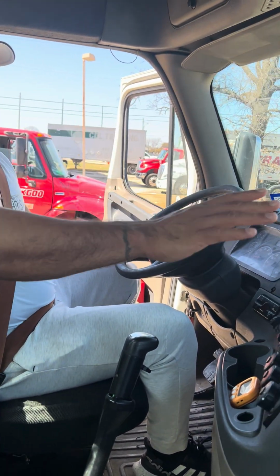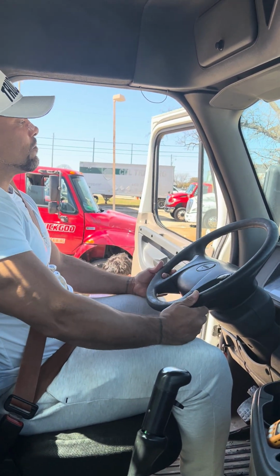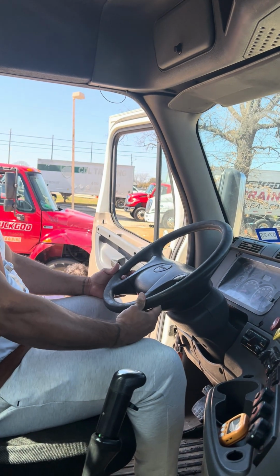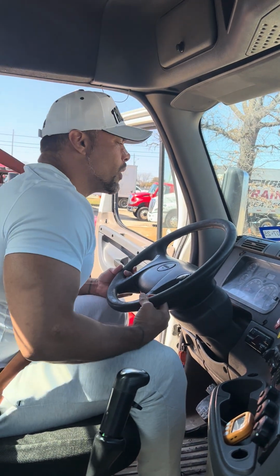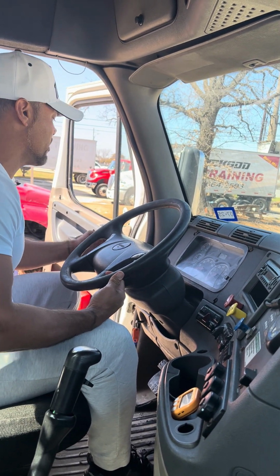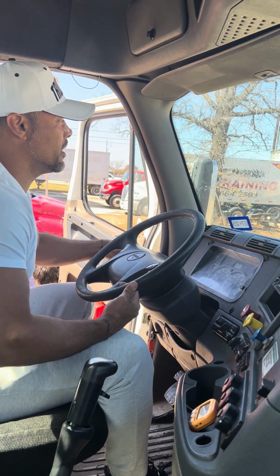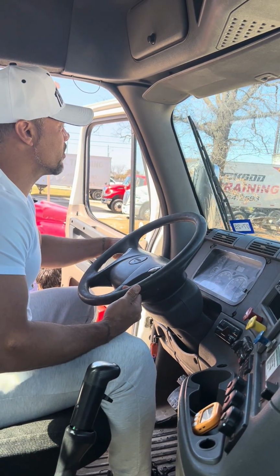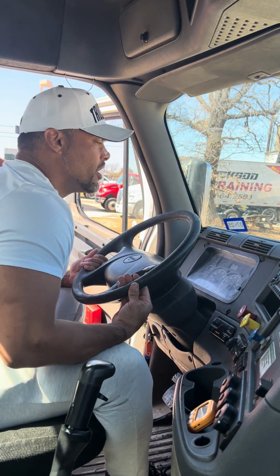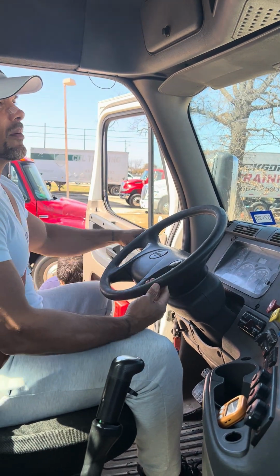My windshield is properly mounted and secured, not bent, broken, or cracked. There's no illegal stickers. My tags are up to date. My windshield wipers are properly mounted and secured, not bent, broken, or cracked. All nuts and bolts are present and tight. We'll give those a test and we'll check the windshield fluid. They're working, and the rubber seals have no abrasions, bubble cuts, or dry rots, and they fit comfortably to my windshield.